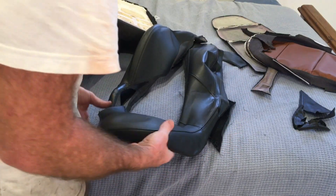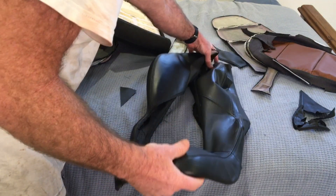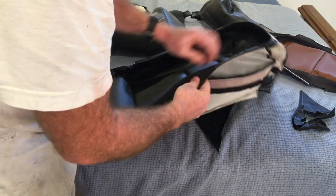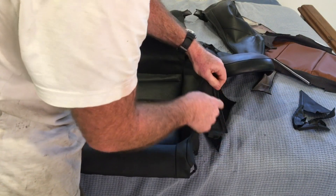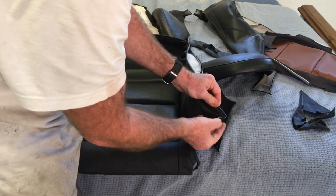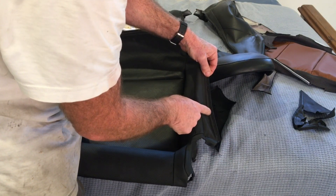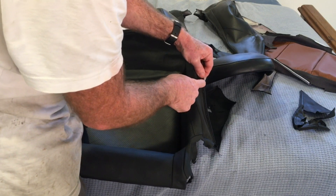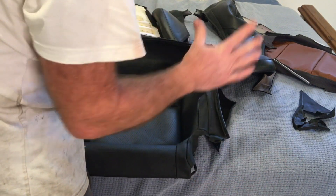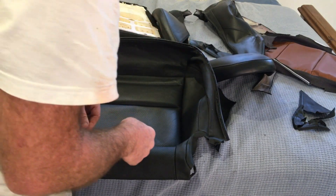Most of the plastic strips for the seat are pretty much exactly the same concept. It's a different profile compared to the other one but the idea is identical. There is a line in the plastic which you line up with the edge of the material, the foot goes hard against the edge, then you run it along and it just puts it in the right spot. Notches on the material with markings — just line them up.